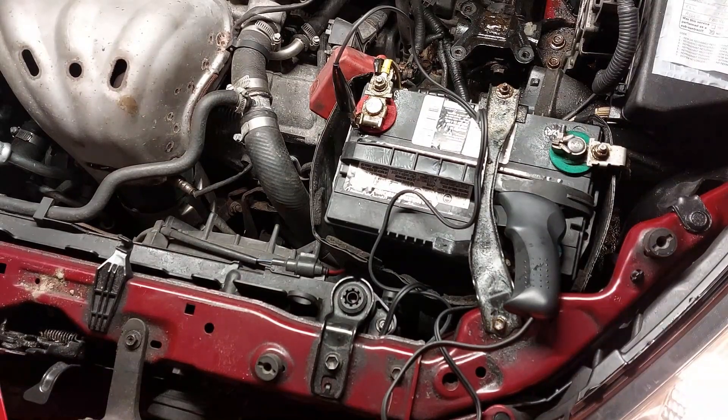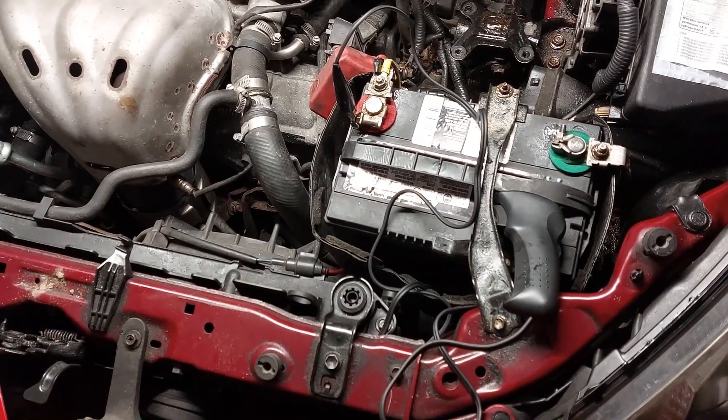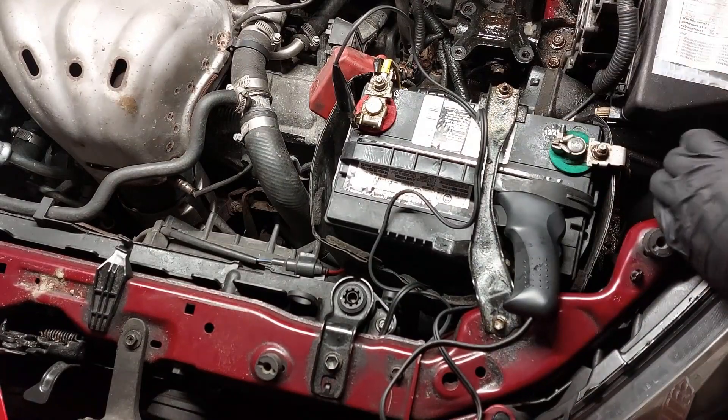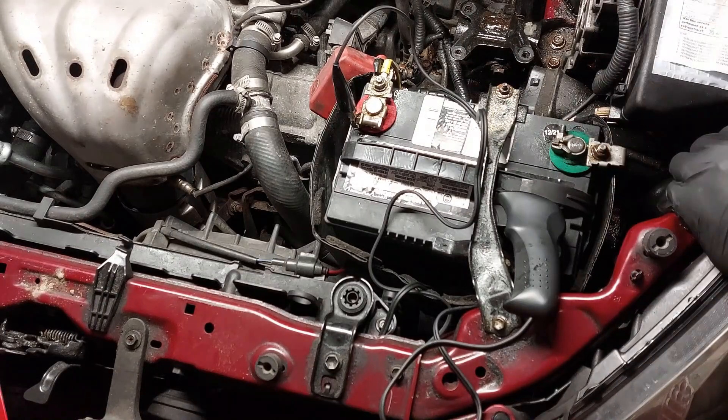Now I'll have to go inside the vehicle to shut it off. You have to make sure that if you want the engine to start, the ignition is on with the proper key — otherwise the immobilizer is just going to prevent the vehicle from starting.